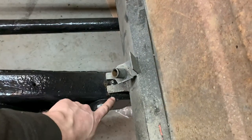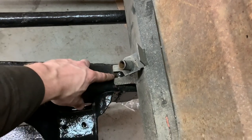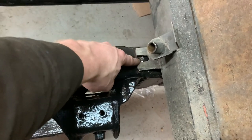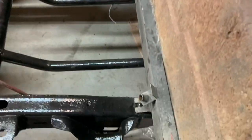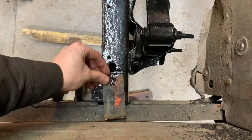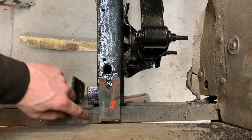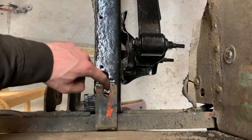Those brackets, I cut them off because this frame has been an inch wider or a half inch wider than these brackets were. And all I've got to do now is weld a stud down here, or tap it and put a bolt in there, whatever. That's really easily done. I actually cut the brackets off, so I was like, what a perfect bracket for me to use. It goes right here, weld it onto the bed, the rail across here, weld it around, and then have another hole threaded right here, put a bolt in it.